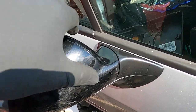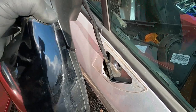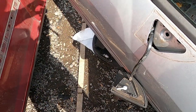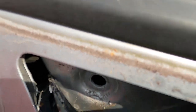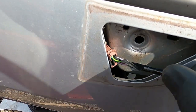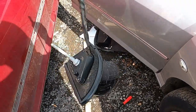Now once the bolt is undone, what you can do is just literally pull out your mirror like this. It's going to be slightly more difficult to pull out because of the clips going through here — the space is not great. So I'm going to use the little tool to flip it to the side a little bit so you can pull it through. Once one is through, your connector is out as well. Now the whole mirror is out of its place on the door.